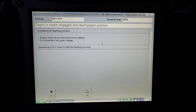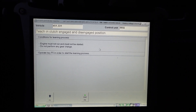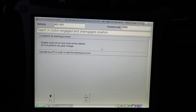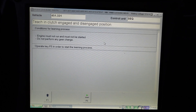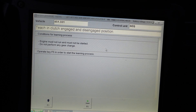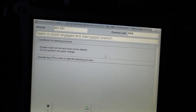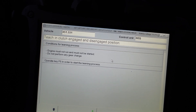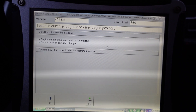This is where you would go to do that clutch adaptation. If you just do this process and get through it and get a successful relearn on your clutch, the car should drive beautifully. Mine always gives me a bit of a hard time because I think there's a little bit of a mechanical issue with my actual clutch — the pressure plate and the disc. But for you guys it should go through the learn process real easy. Hopefully by doing this service you can keep your original clutch actuator going a little bit longer and get a few more miles out of the car before you have to shell out that $700 for a new actuator. If you guys like this video please like, comment, and subscribe — thanks for watching and we'll see you in the next video.